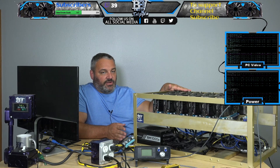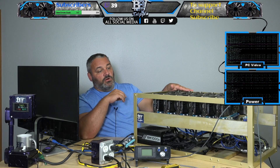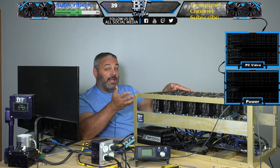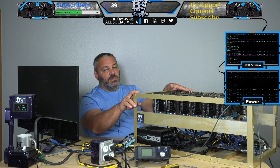A lot of folks doing Windows mining with NiceHash don't care what they're mining — they just know they're getting paid in Bitcoin. A rig like this right now on NiceHash yields anywhere from $7 to $8 a day; I've seen as high as $10, but the average is around $8 a day. This machine is using 750 watts — at 12 cents per kilowatt-hour for a month, that's around $70-80 in power costs.